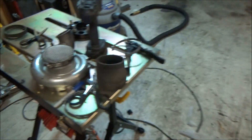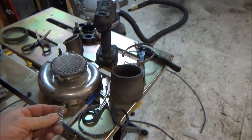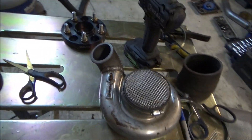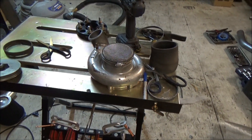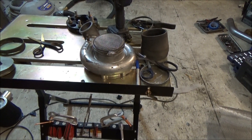Actually, on the last couple cars, I didn't run an air filter at all and had no problems. You just — we changed the oil so much anyway in these things because of the alcohol injection or the richness from being under boost at the track. We don't let them go high mileage between changes anyway. And any dirt that gets in gets in the filters to begin with.